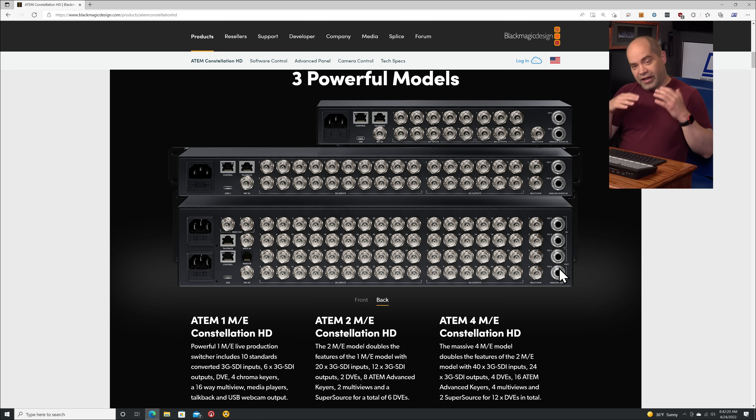If you need HDMI functionality, you're probably better off sticking with an ATEM Mini or picking up a used Television Studio HD, because those actually do have HDMI inputs. Although if you're buying a switcher at this point, I would very highly encourage you to just go SDI out of the box instead of messing with HDMI. SDI is just so much more reliable and works over much longer distances — it's just a better connection type for doing video production. So if you're on the fence, definitely steer towards SDI.